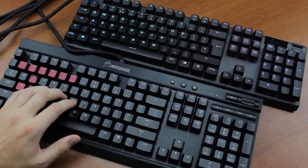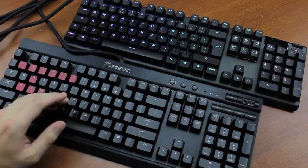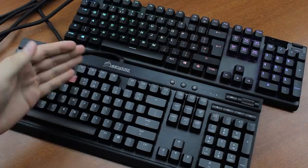This happens to me with Cherry MX Red, for example. And normally, the only way you can prevent this is to get stiffer springs, but with variable actuation, you can just move the actuation point downwards until this doesn't happen anymore, allowing you to keep the light weighting without the problem of unintended triggering of the switches.